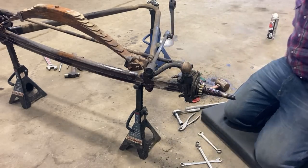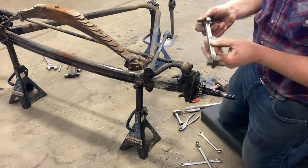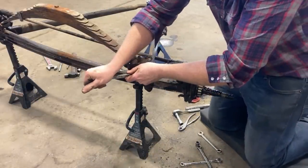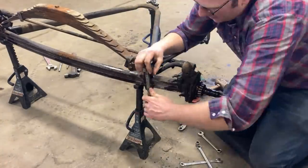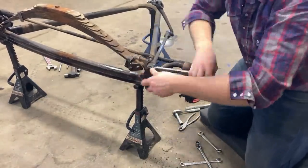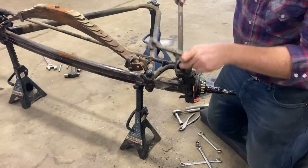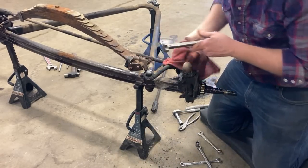and through the use of our beautiful tool here, the old Herbrand, yeah. 193, multi-square and flap. Just get in here, gently apply some pressure, and away you go. Well, there it is. Perfect. See in there, you've got your cups. Mm-hmm. Ball here. And the grease seal. The grease seal. This ball's still fairly round.